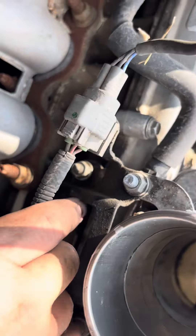There's gonna be this hose right here that's attached to this. When you pull it out, it's only gonna slide out about a half inch because it's attached to this hose that runs down to the side of the block. So you will need to find a way to either cut it or undo it so you can slide it out.